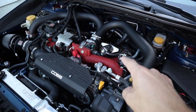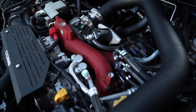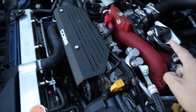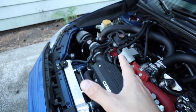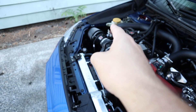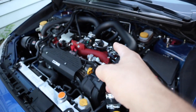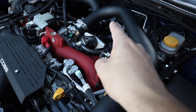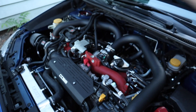We got both those parts installed. The quality of this bypass valve is really nice. I did not want a blow-off valve — my car is not tuned on speed density so we stuck with a bypass valve. I do need to move my IAT sensor from my MAF up into this bung here, because my car is getting so much heat soak from the intake area that the readings from the MAF IAT are not consistent with what the front mount is actually doing. Moving that sensor up into this piping is going to give a much more accurate reading, and that'll probably happen before the next tune.